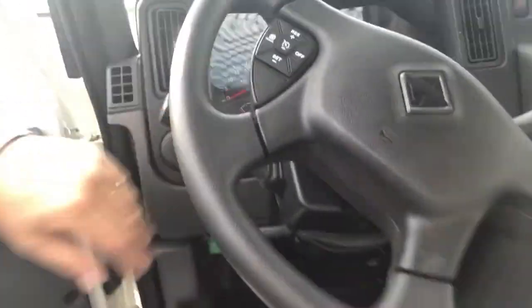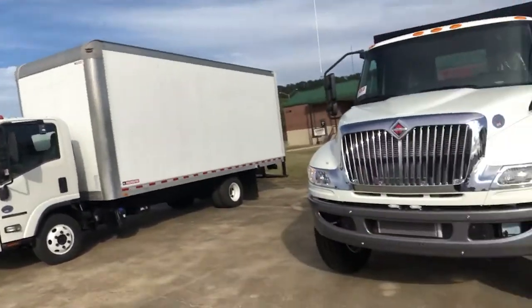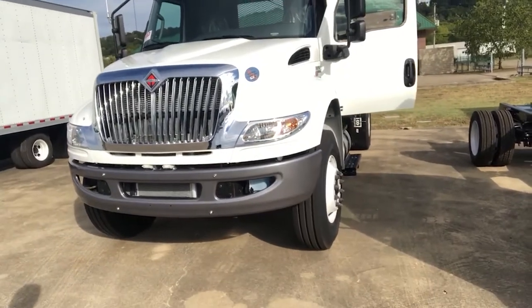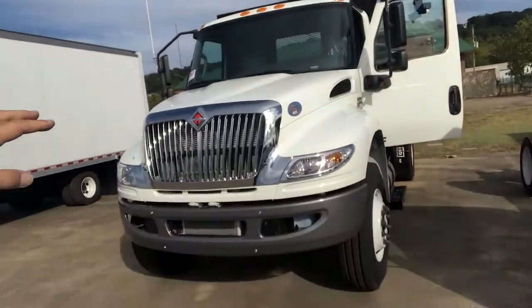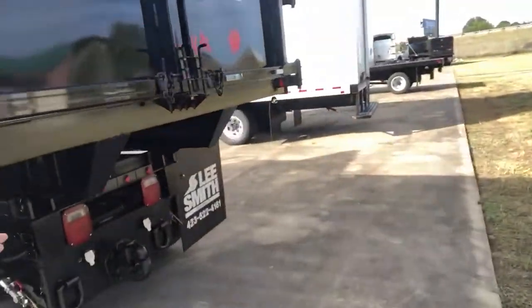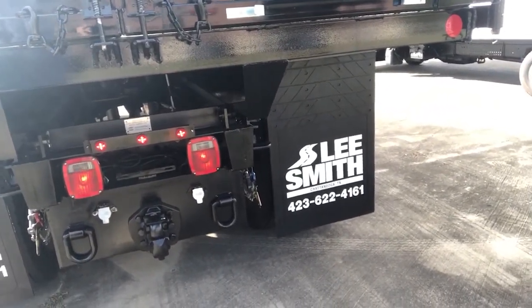When we push the light check button to check the safety lights, it goes through a process of checking your marker lights, turn signals, brights, lows — everything except your backup lights. It will cycle through an entire second increment to go through your standard lights, bright lights, and marker lights, and the third segment will turn all the lights off. This is also going on at the back of the body. We have the marker lights going off, and we're taking a look at the turn lights — four-way, right, and left.